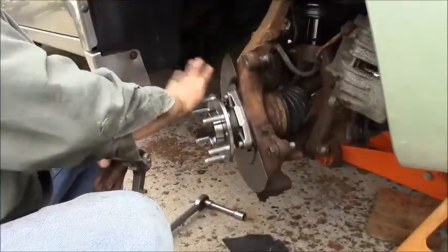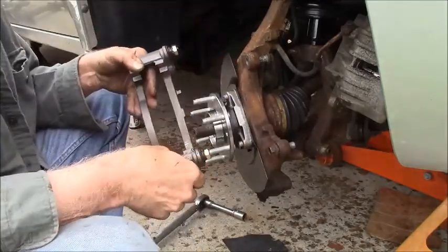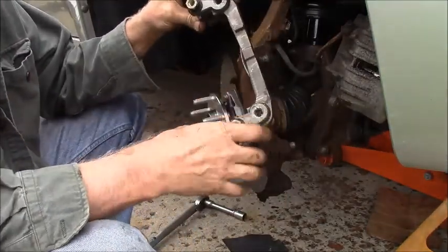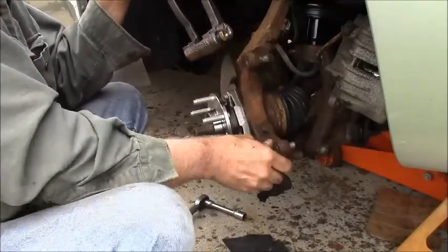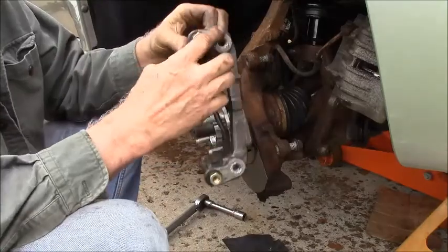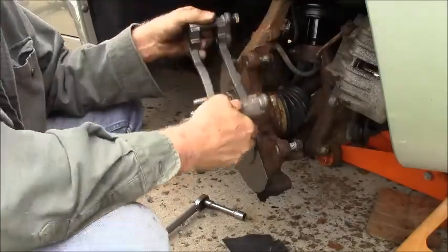Okay, I'm back again. I got the hub end, backing plate, everything's torqued. Wires run, plugged back in for the sensor. Okay. My bracket with the shorter hole span for the non-XL version. Be careful of that. I got my pins out and lubed and back in. I got my anti-seize on everything. This is the right bracket.